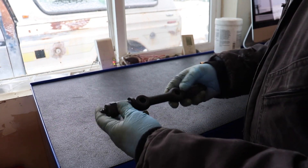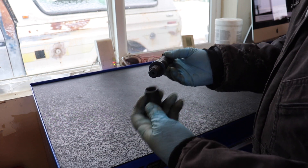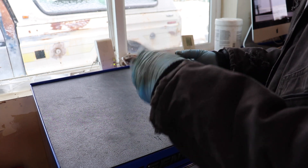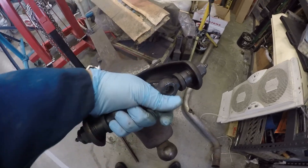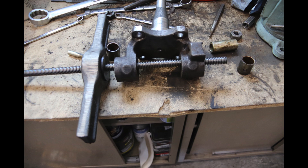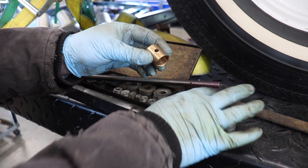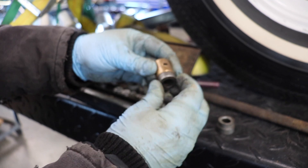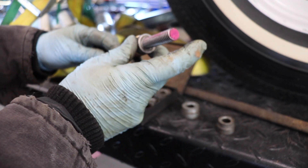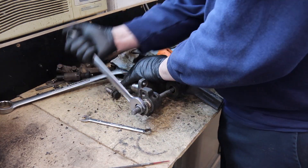All the joints on this type of car are actually just a threaded rod. What would be a ball joint on a more modern '60s or '70s car — these are link pins. They're fairly easy to take apart because it's just threaded, and odds are the threads are worn out from moving back and forth. What you see me doing here is — I've already driven out the kingpin and I'm working on the spindle itself, using Acme thread and a pilot bearing bushing drive kit for blind holes with shouldered units that grab just a bushing.